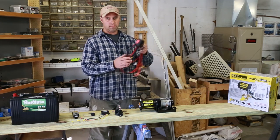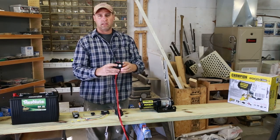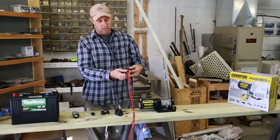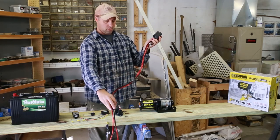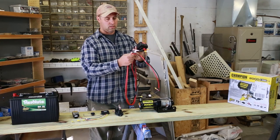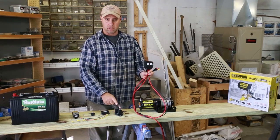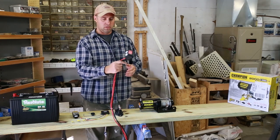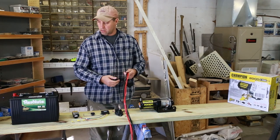Here's what it comes with — it comes with this big contraption here. You just got the up and down switches. This goes down, this goes up just by pressing it in. Really the problem with this thing is all the voltage has to run through this whole cable up through the switch then back down to the winch. So you got four wires: two of them go to the winch, two of them go to the battery, and all this thing does is reverse the polarity — the same thing that this little solenoid here is going to do. So we don't really need this in the setup I'm doing.